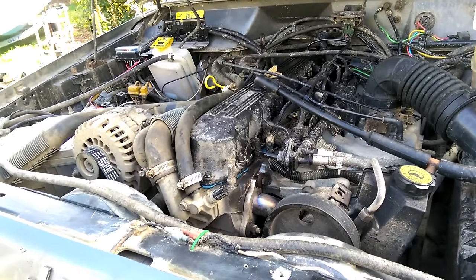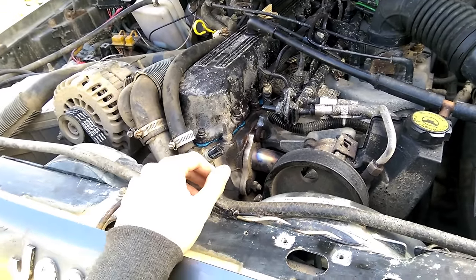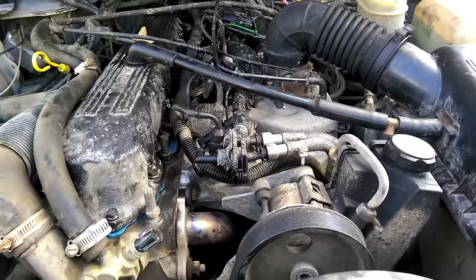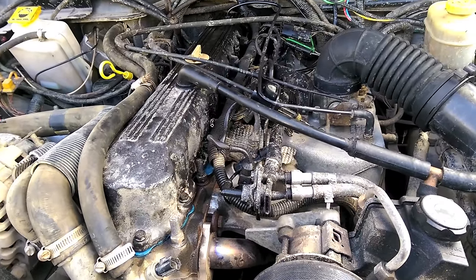I found out you don't need the valve cover — you can reuse your old valve cover on the new head. All the heads will fit on all the blocks, no problem, there shouldn't be any issues. It's between the intake and the exhaust because ports changed. The other thing you can do, which helps with a lot of power — the last head on the XJs was a 0331 head.